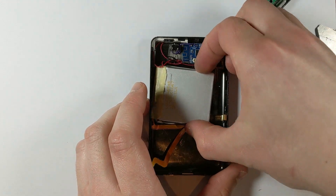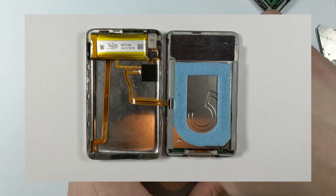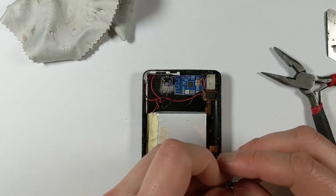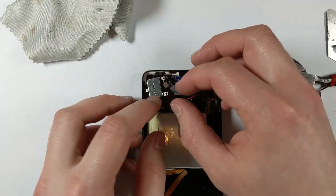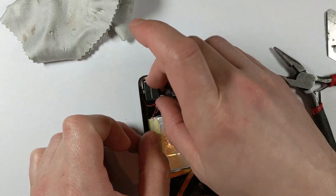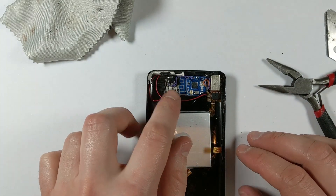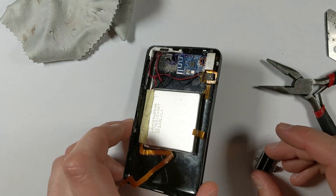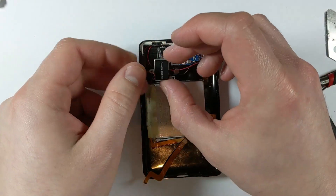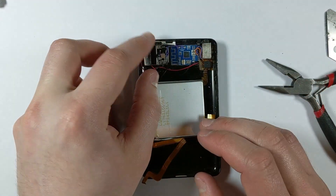In order to complete this mod, you'll have to replace both the hard drive and battery as there's just not enough space to fit all of this with the original ones. Now let's pick a position to mount it. With the setup I'm using, there's just enough space to fit it in the spot where the original battery went and still have enough room for all the Bluetooth mod components as well. It'd also work in the slim version if you went for a 3000mAh battery and an iFlash Quad too. When it comes to the thick version, obviously you'd have much more space to work with.